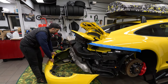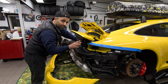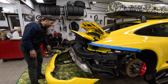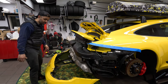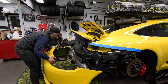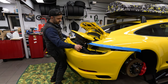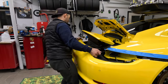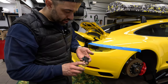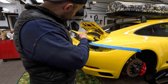It's almost hard to believe we're at the bumper connection phase. You'll notice I've attached masking tape here — my car is fully PPF'd so I don't technically have to, but I'm doing it myself just in case I ding it while attaching the bumper; it gives extra protection. As you're reattaching the bumper, be mindful of the cables — they have to plug in on each side. The bumper screws are all the same except the more oxidized ones are from the bottom, so we're going to pick the cleanest ones and put them up top.